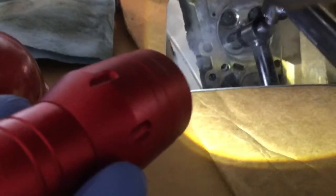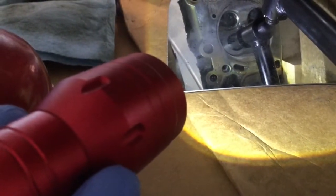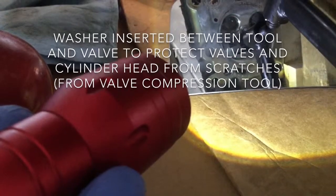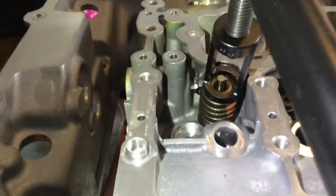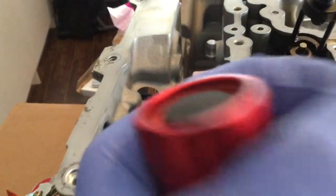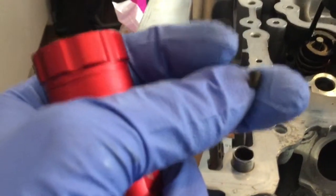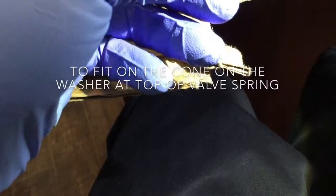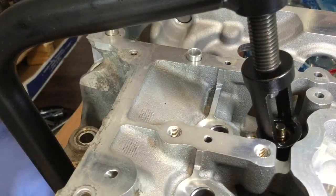It helps to use a mirror to make sure your washers and other parts are well located underneath the cylinder head - looking underneath isn't necessarily easy. If you have a mirror that's going to help a lot. Then you just squeeze the spring and insert the little keys. They have to go with the cone - bigger part up - to fit into the cone on the washer. Don't forget to put a drop of oil on the valve rod before sliding it in.